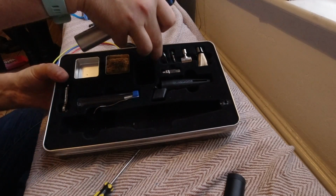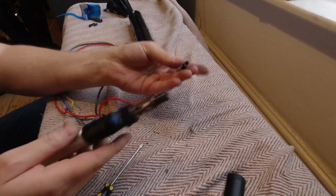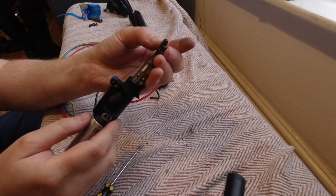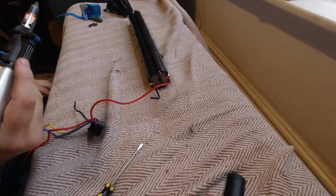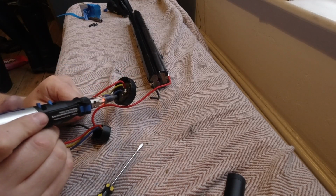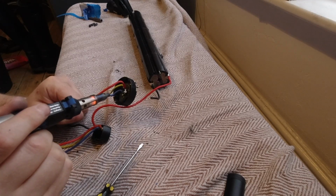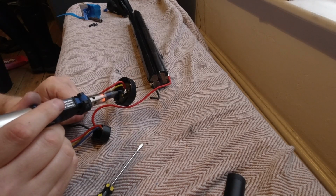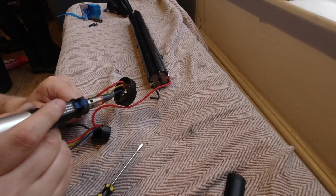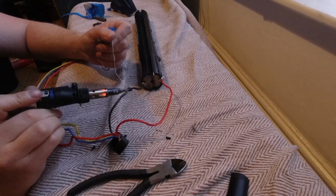So as you just saw, I got the drill and cleaned out some of the connections, and now I'm going to get the Dremel Versatip, link below if you want to have a look at that. Even if you don't want to buy it, just have a look, because it's a brilliant tool and it's not expensive. And I'm putting the heat air blower tool on there, which is really good for melting glue, like if you used a heat gun, to re-melt it, or to just melt a bit of plastic to move a connection around like this, because the connections in this were put into the plastic, and then they've used a glue gun to put glue all around it to hold it in place. So I just used that to melt it and put it back in place, because it was so badly melted.